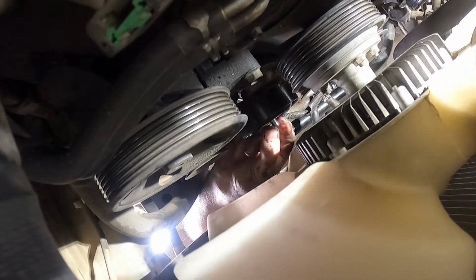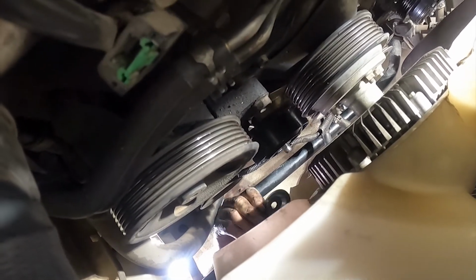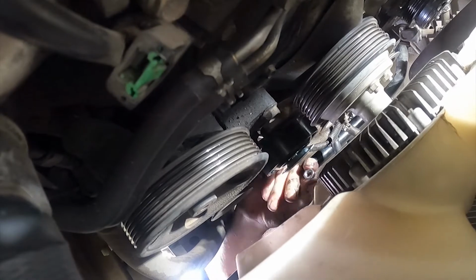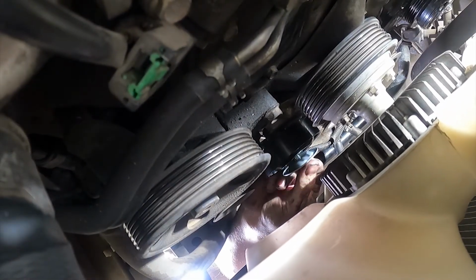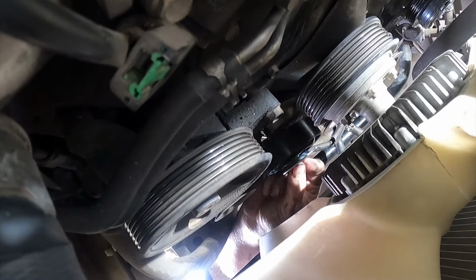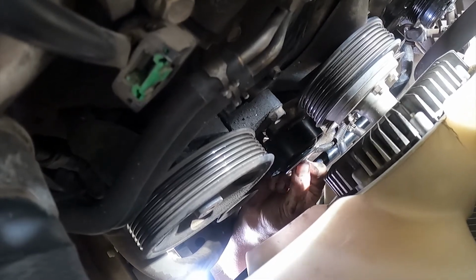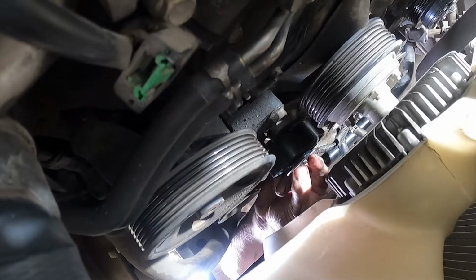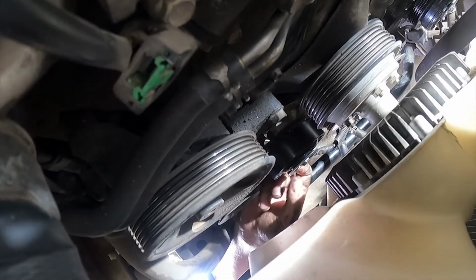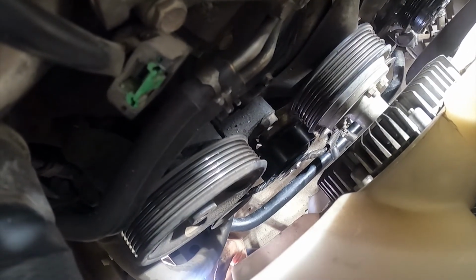So now we're going to put the outside spacer on. And we're going to put the shield on. And now we're going to get the bolt on. Again, after you get it all snug down, you want to make sure that it spins freely. All right. So we're good. And we've got slide, so we can now put the belts on and tighten it all up.